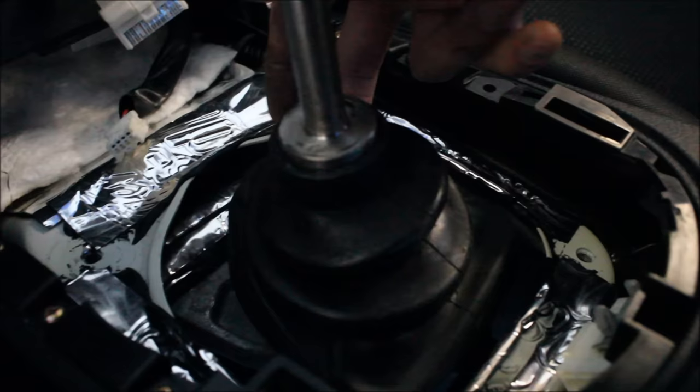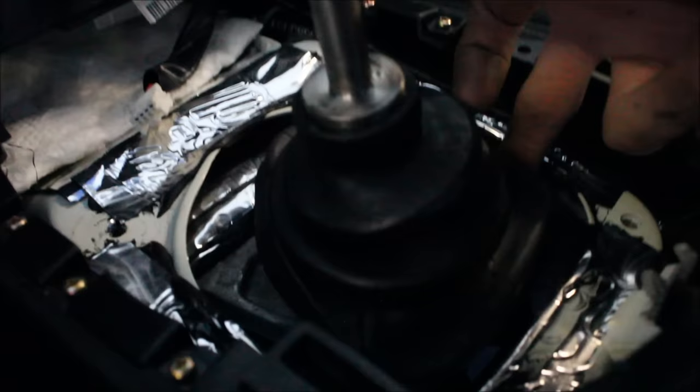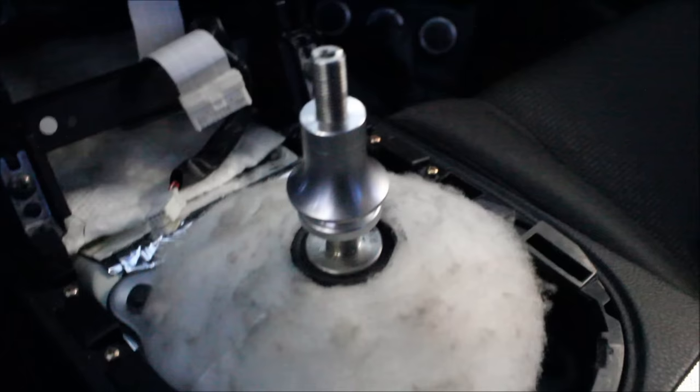For the first boot in the interior, make sure you take your time. Because of the spacer, it's not going to fit on exactly like it did before. Make sure you have it wrapped around and it catches, then feel around to make sure it doesn't want to pop up. Because when you're driving around you're just not going to notice it, and you'll neglect this piece — you don't want it popping up over time and then dirt getting in there.